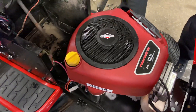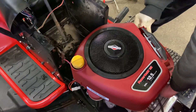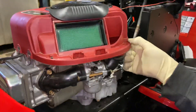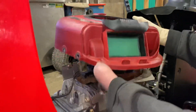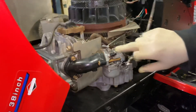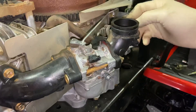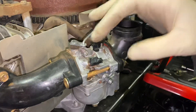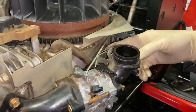We're going to have to take the air cleaner off. Pull this off your housing. These front bolts are a little shorter with the shoulder, so just make sure you put them back in the right spots. It gets pretty tight where the neck of the carburetor comes into the housing — you kind of have to wiggle and jiggle that off, and then you can slide it right up. I didn't have to take the air cleaner off but it worked out well. Now we have the problem spot right here — this was hanging up. Because it's plastic, that's our issue. If somebody ever sprayed any kind of gum cutter inside this carburetor, that would actually make this plastic swell a little bit.